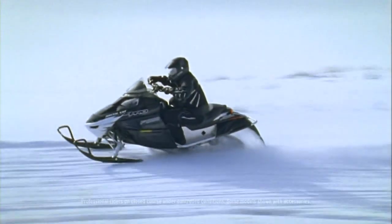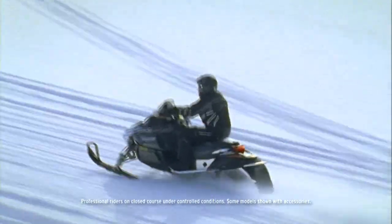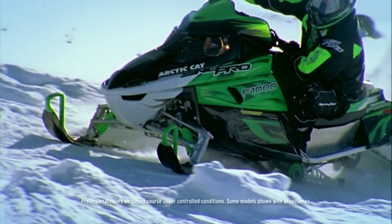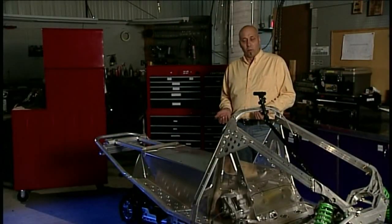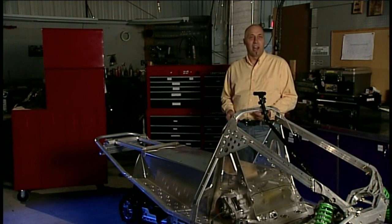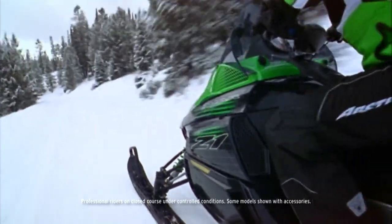When you drive a conventional snowmobile, your feet are up in the stirrups, and you're kind of stuck on the seat where you're sitting. Well, in the new sled, you can see that the running boards are flat, and they give you the opportunity to move around a little more. A lot of people, when they're cornering a snowmobile, still feel that they want to hang off the edge of the snowmobile, or if they're going through some rough terrain, like to feel hooks on top of their toes. We made that adjustable, so for people that want a tighter toe pocket, they can have it, or people that want loose or have a lot of movement with their feet in the toe pocket area, they can also have that.